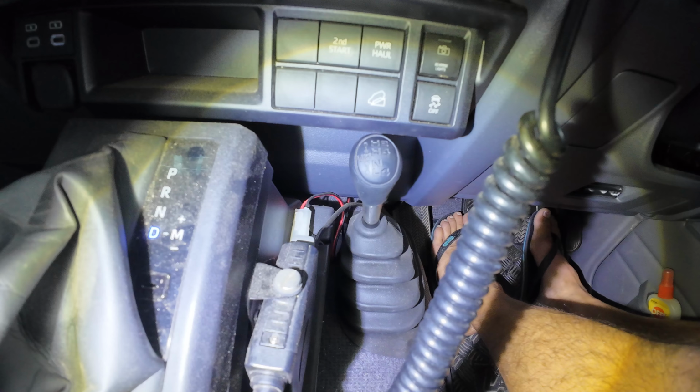Why would you buy a 70 over some of the other dual cab utes on the market these days? The towing capacity is up there, the power is up there. If you're looking for a live axle and something you do want to take off-road, these come factory twin locked. They've got a live axle front. They're robust. You're not going to go breaking CVs, even with a 35. You put 35s on something like a Hilux or a Navara or a Triton, you're going to break CVs. You need to put that locker in the front to get the adequate traction that you're going to have with these from factory. You get a low range stick over the dials.